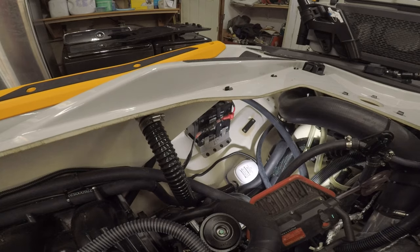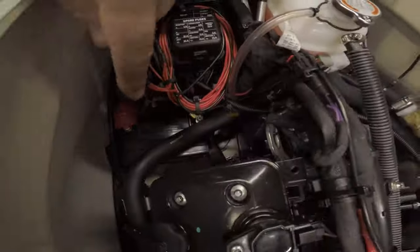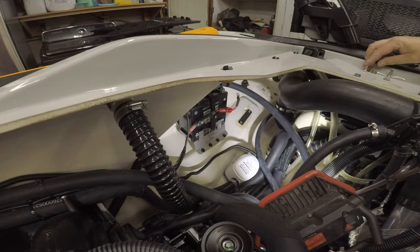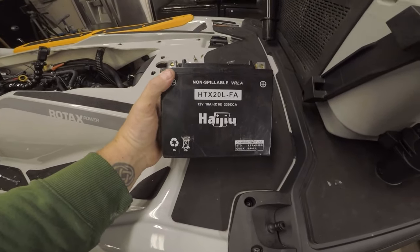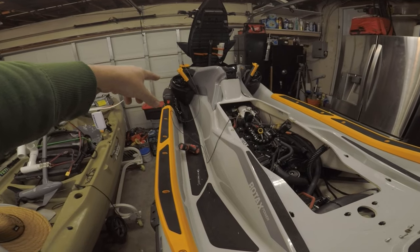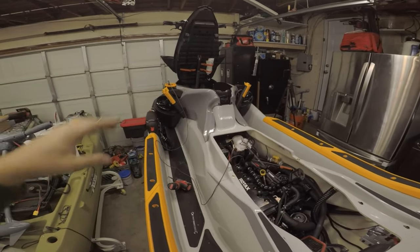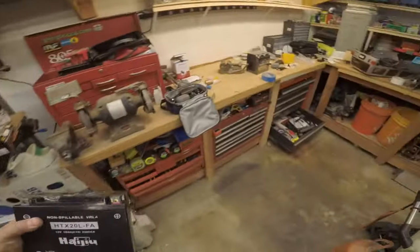Let's remove the factory battery. Underneath the front battery terminals there was a small brass spacer between two lugs — keep an eye on every little part that comes out. The factory batteries aren't bad, they're just not enough for what I want to run: music all day, fish finders, turning it on and off at fishing spots, and eventually a fixed VHF marine radio on board. I want the freedom to run those accessories without worrying about battery consumption.